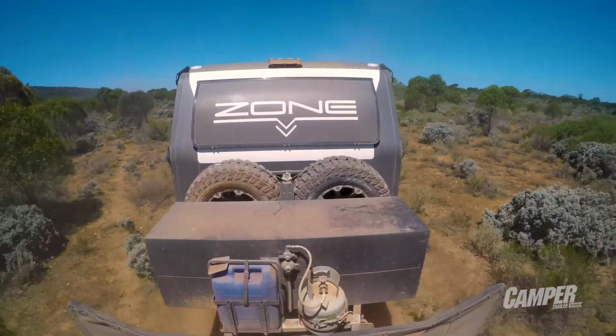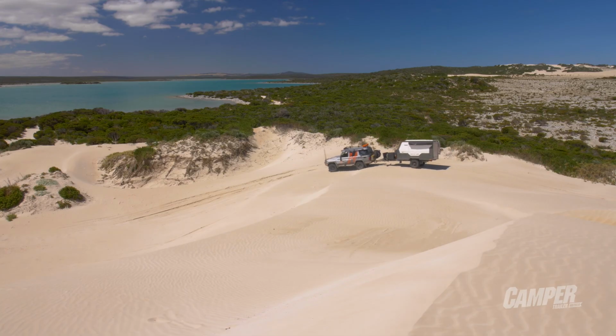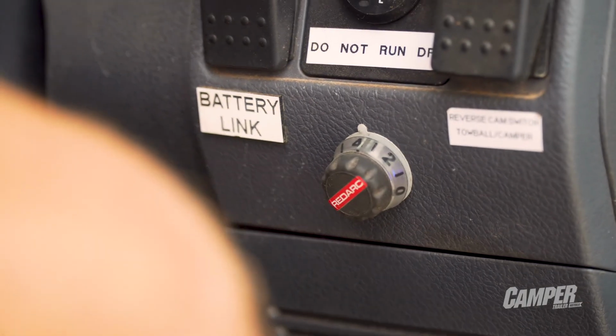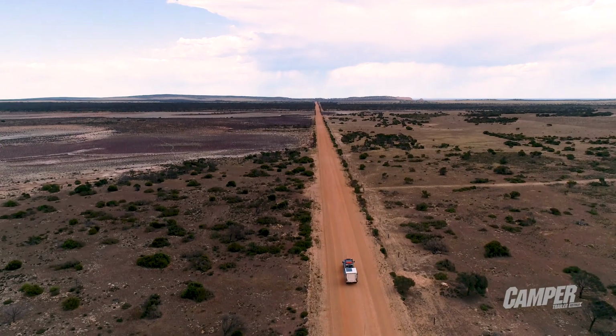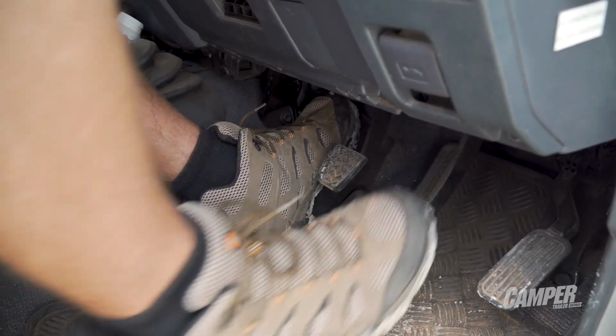This particular unit is definitely unique when you compare it to most of the models in North America and around the world. It has a 3-axis inertia switch, which allows it to be mounted in any position, but also gives it a lot more information for proportioning. So when we leave it in that proportioning mode, when we're driving along, it's sensing that braking input.